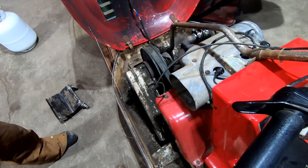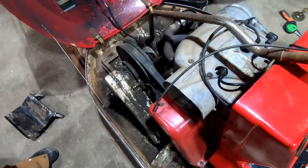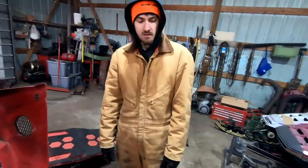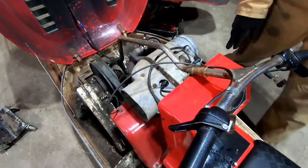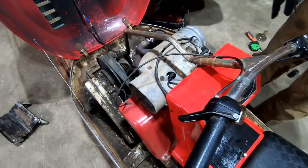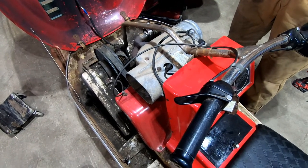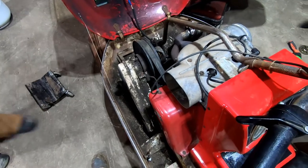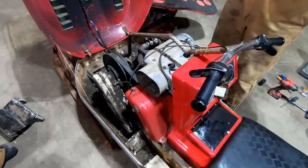Once these things sit for over a decade, you've got to redo the points. You want to get OEM Bosch points — apparently the Chinese knock-offs are problematic. We know it's not a spark plug because we changed them and it ran really poor. The spark tester got so bright — I thought it was gonna bust in half, like a goddamn balloon.